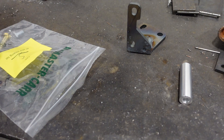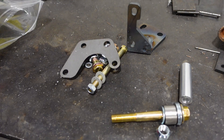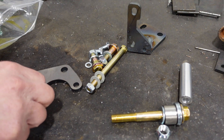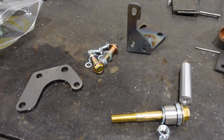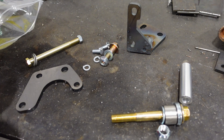With the ribs, you'll never have any problems with slippage. As far as pumps go, the GM and the Ford both work. The Ford style from a 7.3 Power Stroke is what you want to use — they're usually about $60, though right now there may be a shortage so you might pay more. GMs are usually closer to $80 to $90. Note that the 6.0 Power Stroke Ford vans like the E-250 used a pump with a much longer snout, and those will not work with this kit.